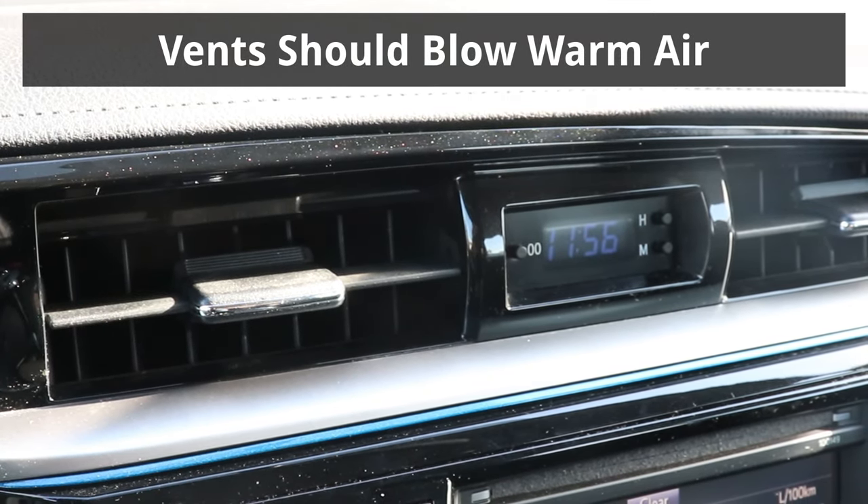And I'll go for a 10 minute drive now, making sure to check the temperature gauge more often, and then I'll check the reservoir level and for leaks again after driving. For the next few days, it's important to keep checking the reservoir level and for leaks daily, to make sure the coolant level stays topped up. If you found this video useful, please make sure to give it a thumbs up — your support is really appreciated — and consider subscribing to my channel, I'll be posting more videos in the future. Thanks for watching!